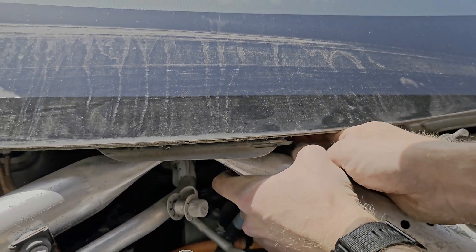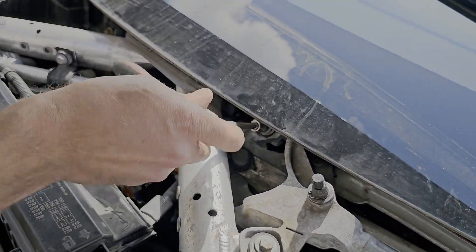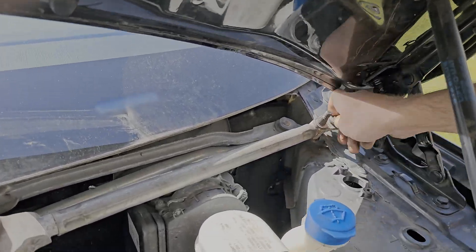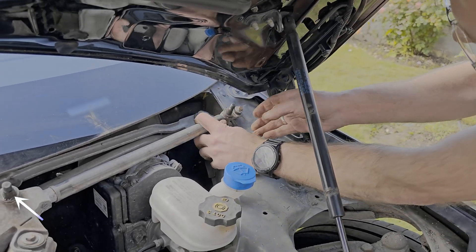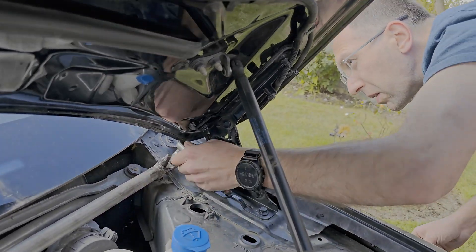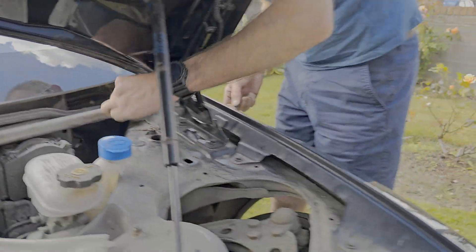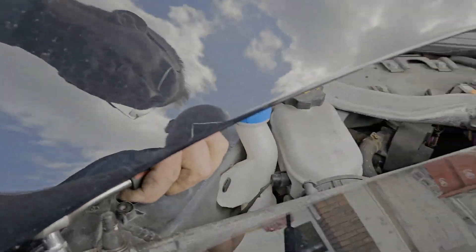Careful with this screw — don't drop it, you won't be able to find it. Torque all three screws; I don't know the exact torque, but make it tight, not too tight as they are sitting in rubber suspensions. It's very important to clean these toothed cones properly, as well as the cone sockets in the wiper arms, and degrease them — you don't want the arms to spin on the cones in winter when wipers have more resistance. Don't forget to replace the two plastic cup washers on the pins before replacing the arms; they further reduce water ingress to the bearings.